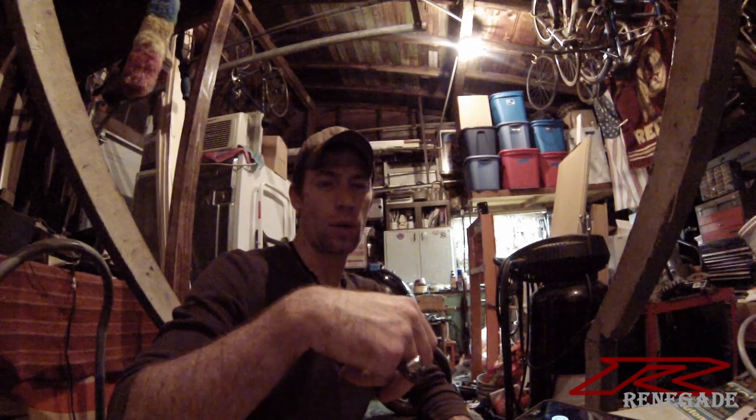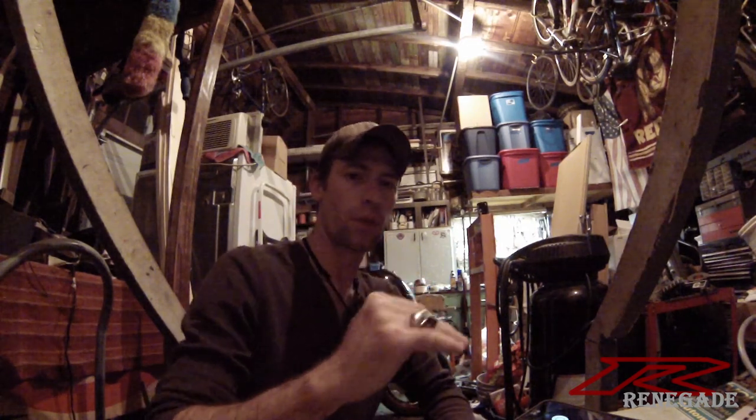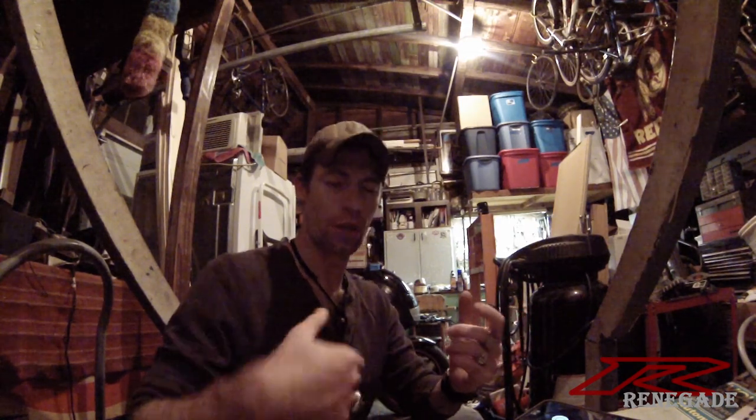Since I'm talking about the main jet, let's focus on that. I get to three quarters of a turn, go farther, and you can hear the bike die off — it goes flat and there's no power. This tells me the main jet is running rich. If it wasn't, it would continue to run until it just ran out of power. That dead flat sound is what gives me notice something's wrong. The flip side: if it started getting tinny at high revs and high throttle, you'd know it was running lean.